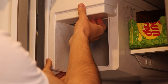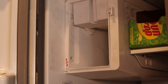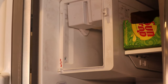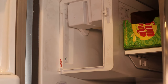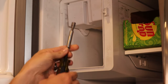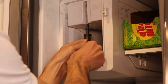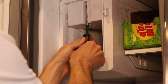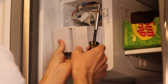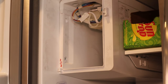We've got the two screws off. You can simply pull this straight off forward like that — everything comes off nice and easy. The next step is to remove this little plastic tray in the front here. For pretty much everything else on this whole teardown, you're going to need a quarter-inch nut driver. We're going to go up here and take this little panel out. That just comes right down. As you can see, there's a whole bird's nest of wires in here.